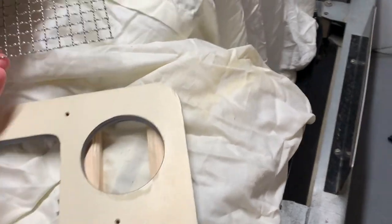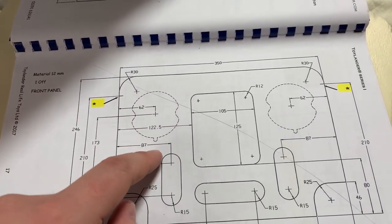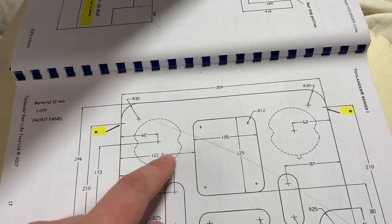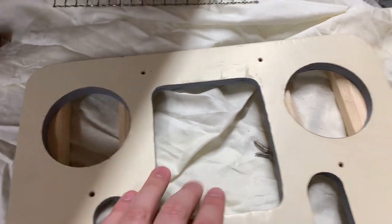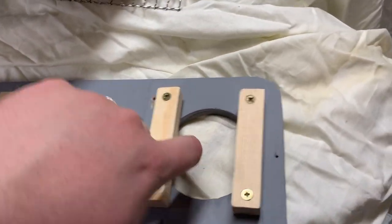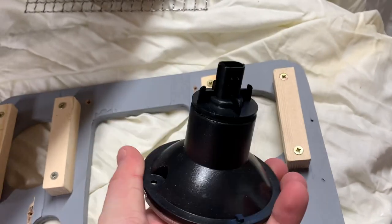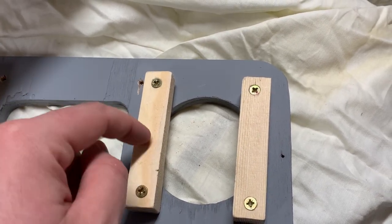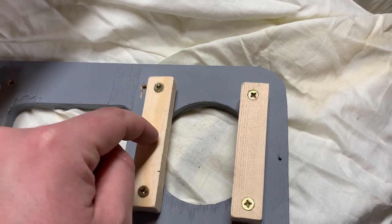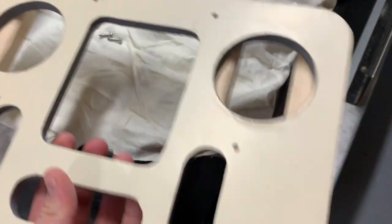The manual shows an irregular shape for the headlamp hole, but I've cut it as a circle without the little indents. I've put two buttons on the back on each side and chamfered the edge because the back of the light isn't flush — it has a dome shape presumably for reflection. What the buttons do is allow me to drill through from the front and put screws into them rather than into the front panel itself. It's not quite as tidy but slightly more simple. So the front panel is nearly finished.